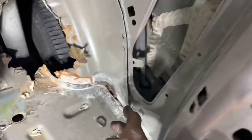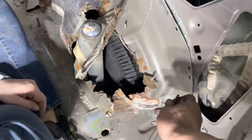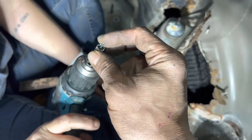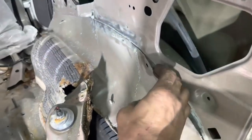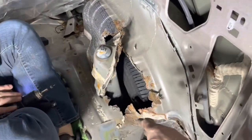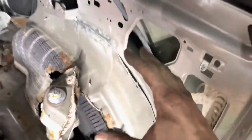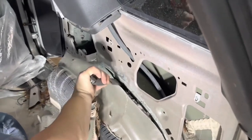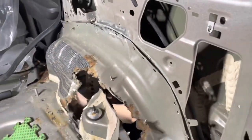Once we've exposed our spot welds and removed the glue, we go a little further back than necessary to get to the spot welds behind the lip and the metal behind it. Pat is starting to remove the panel from the outside edges — first she's taking a beveled punch and punching the center, then drilling a pilot hole so the spot weld remover stays square. She's not drilling all the way through, just prying the panel apart to confirm it's separating. We also check by hand if the archway is rusted through — in this case it's not, so we'll save this gentleman some money.